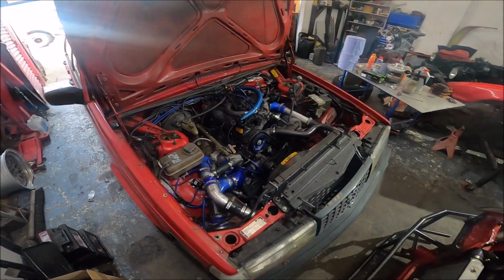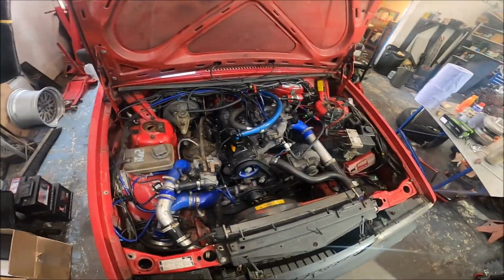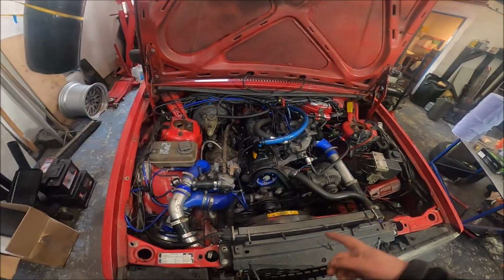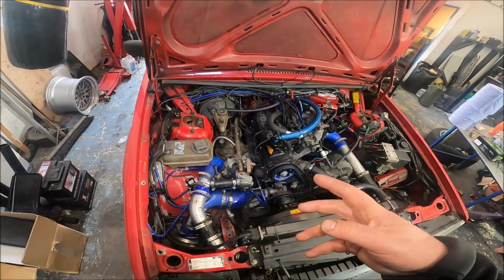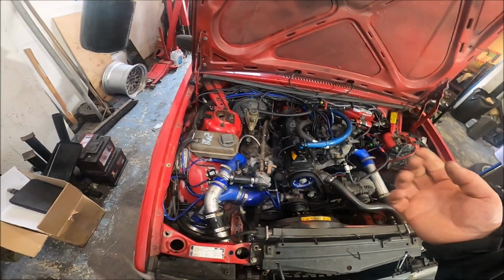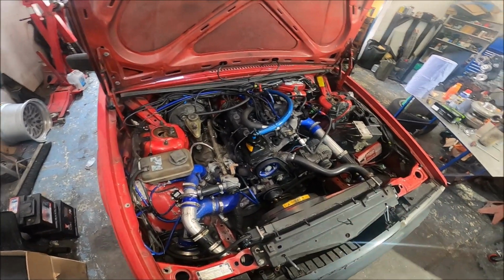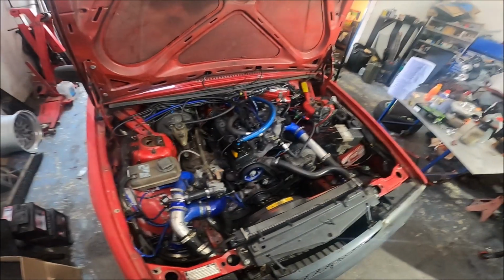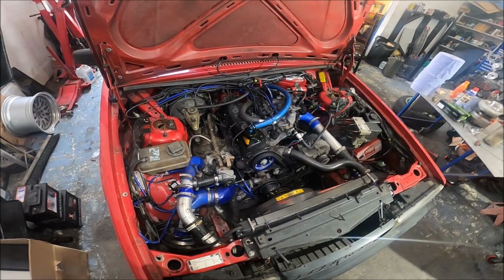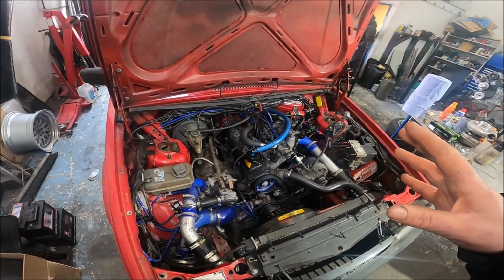Right, Volvo's in the workshop again this afternoon because I'm going to change the turbo, and change it for that Chinese GT30 over there. Basically, I smoke tested it last night, no leaks. It's still got the power it's always had, maybe a tiny bit more, but it is super mega slow spooling, like power band. I don't think full boost is until about 5,500 RPM, even in a higher gear, and with no leaks and no issues, and it drives lovely.